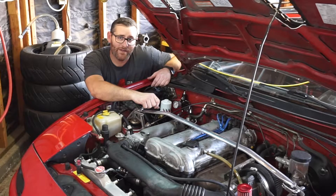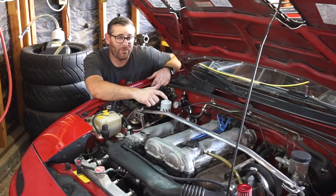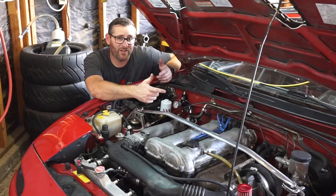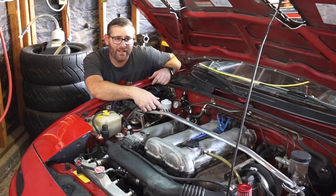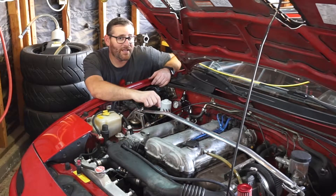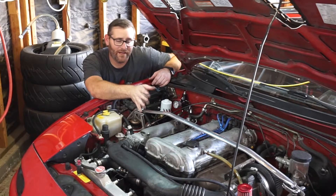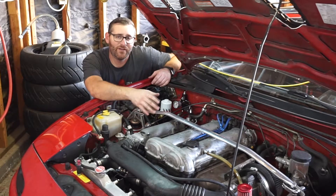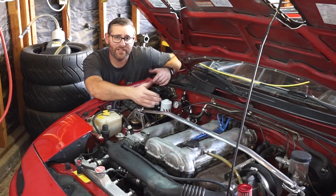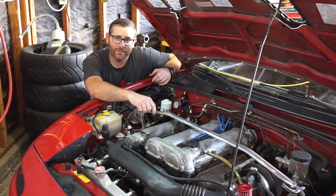We're looking to get a little more power up top where we're seeing about 10.8:1 air-fuel ratio — we want to shoot for more like 12.0 to 12.7 to lean it out a bit, as it really felt like we were struggling to pull at the top end. We might even be able to get on the dyno at Yemi Sport to see the actual difference in power between running at 10.6 AFR at the high end versus 12.7, to put a real number to it.